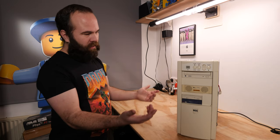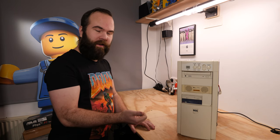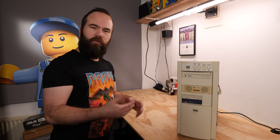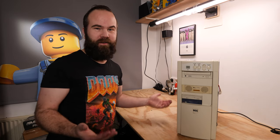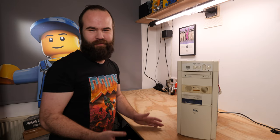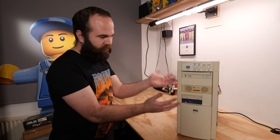The first problem was the speakers are not working and the hard drive was annoyingly loud. The CD-ROM player had trouble with reading some CDs, and the floppy drive wasn't working. Also, the drivers weren't that great, the Voodoo Rush didn't even have 3D support. I tried and filmed running Half-Life on this machine in the previous video, but I just cut it out, it was not working. Only in software mode with 50 frames per second. So let's dive into the system and fix it up.